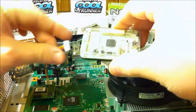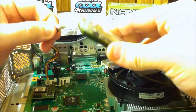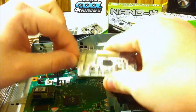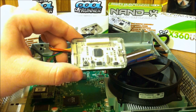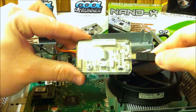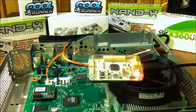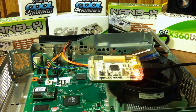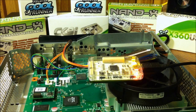Push down, make sure they're all good — they are. Then go ahead and plug that into your NandX like so. Make sure you've got it going the right way. Then plug the USB cable into the NandX right there, and now we will go to the computer. This is just for reading the NAND, which is all we want to do before we go any further.